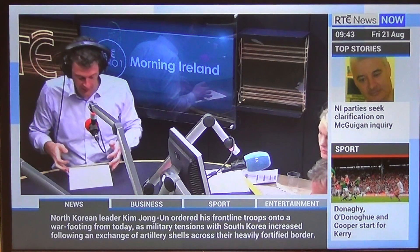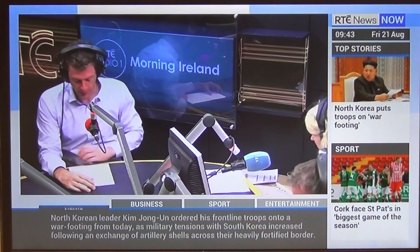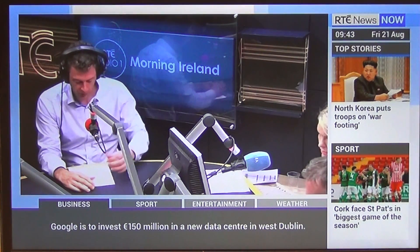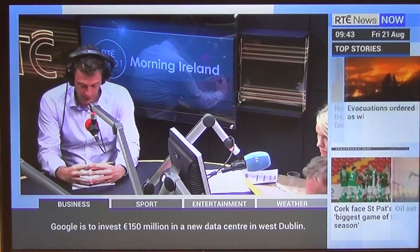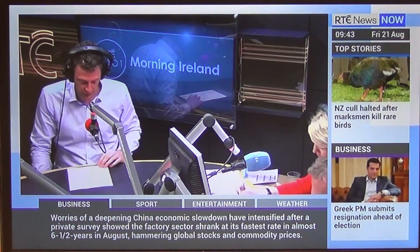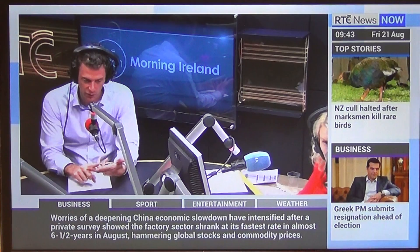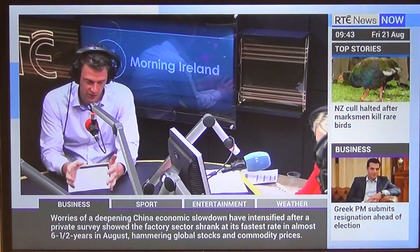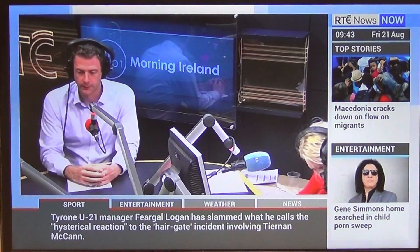You can see the hard drive has worked. The big advantage of the internal hard drive is you're able to use all the great features like schedule recordings and all the rest of it. The other fantastic thing is that it minimizes any chance of corrupting the cache, because you're able to set the paths to default. Rather than risking that a 7-day EPG will end up corrupting the cache, it can be stored on the hard drive. We're always recommending people to ideally have an internal hard drive — you could use USB instead. The format on this is ext3, which is the default Linux format.